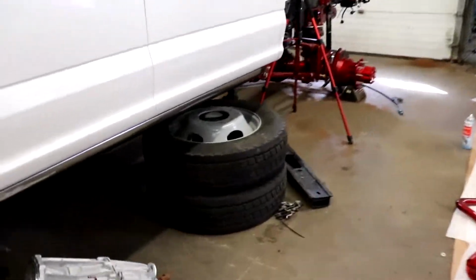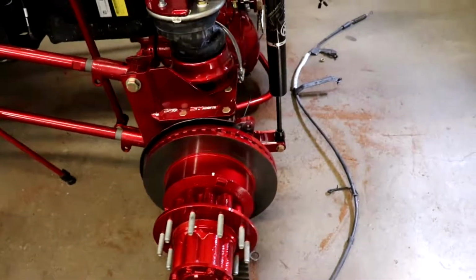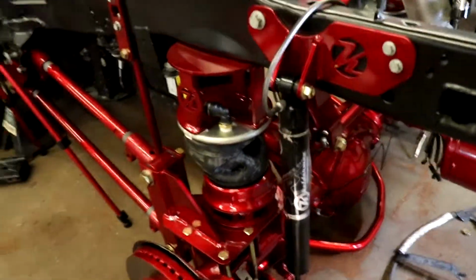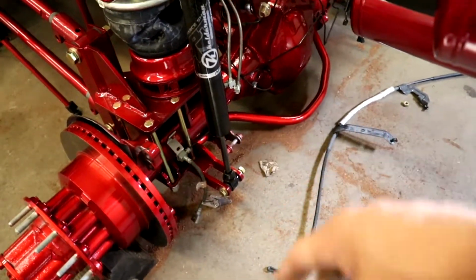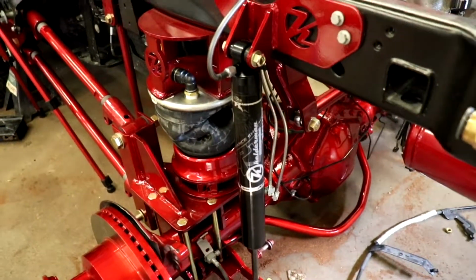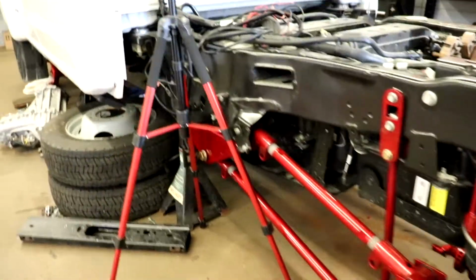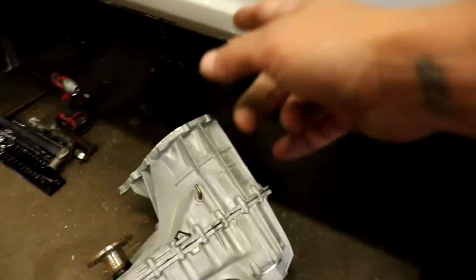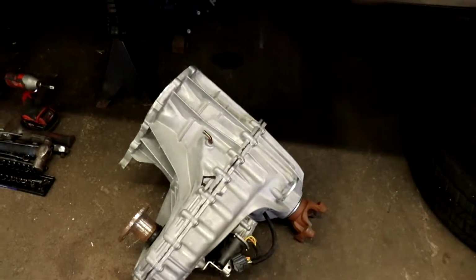After I get that on, I want to get these rear calipers on. The pads are just over there. And once I do that, then I can take these brake lines off, because I'm just stopping the brake fluid from leaking out of the brake lines. There we go. Holy shit. So yeah, I've got to get that done. And then once I do get that clock up on there, I'm going to get one of my coworkers to give me a hand, just tossing this up and in.